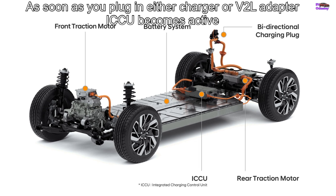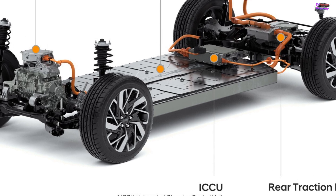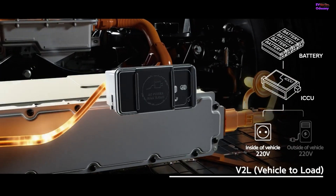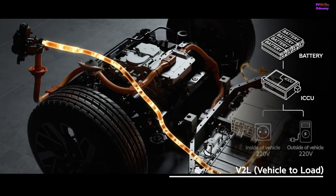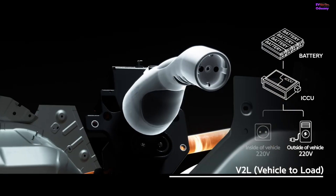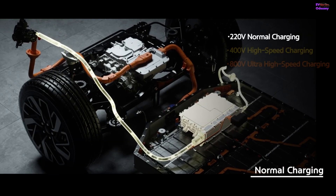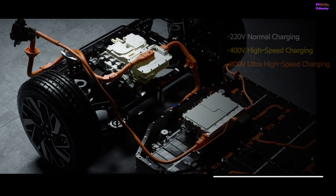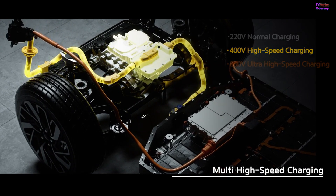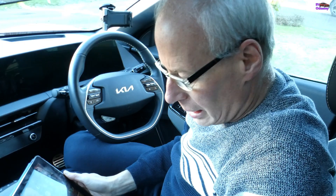The reason this works is the big inverter under the back seat called the ICCU — that stands for Integrated Charging Control Unit. It handles the output from the main traction battery which comes out via vehicle-to-load, and it also handles other charging functions including the 12-volt battery. So when this gets activated, it charges the 12-volt battery. It also handles AC charging at 220–240 volts, 400-volt DC charging, and 800-volt ultra-high-speed charging — so it's very important.